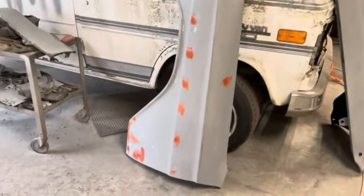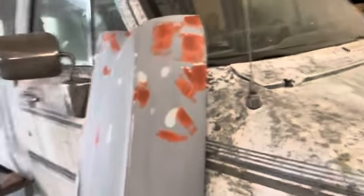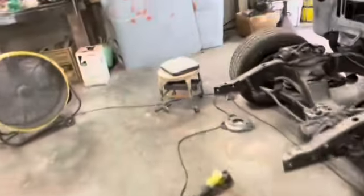All right, so I got that fender sanded down. Came out pretty good, but just up here especially, there's a lot of pinholes in that filler. I don't know why. So anyway, we spot putty them, and we'll have to sand those once it dries. I kind of started sanding those over here on the deck a little bit. I have one there, can't even feel that anymore, one down there. I just take that 320 on a block. That stuff sands off really easy and really nice. So I'll just do those as we go along.